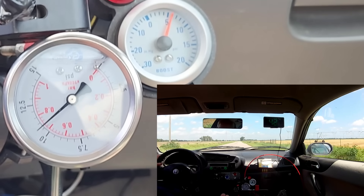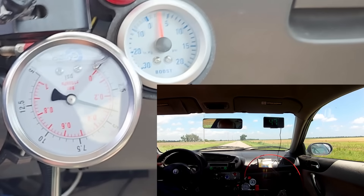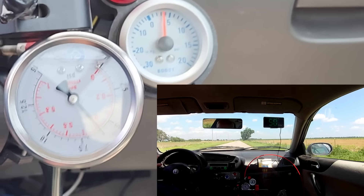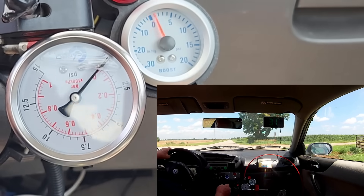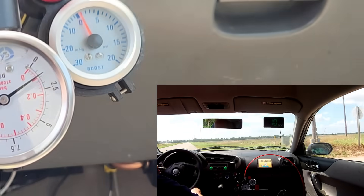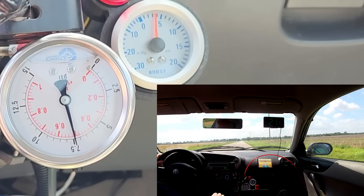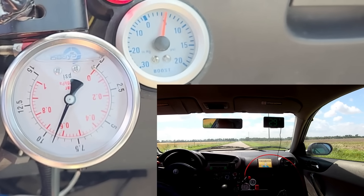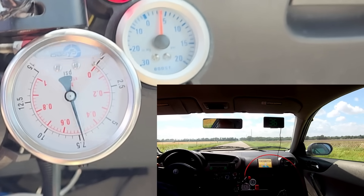Some of you folks may have noticed that we didn't touch the fuel rack settings at all, and that's on purpose — we're only adjusting one thing at a time. Even though we didn't fiddle with the fuel rack settings, the engine does get extra fuel on acceleration because the governor slams the fuel rack to the max until the engine catches up to the throttle position. This is kind of a tractor thing — normal diesel cars and trucks don't do this, but our engine does because it's an industrial engine never intended to be used in a car. My gut feeling is adjusting the factory setting is not the direction we need to be going. But on the other hand, the car seems faster — however, I don't have any proof that's true. I reckon the right thing to do is to do a series of performance tests, including the dreaded fuel economy run.